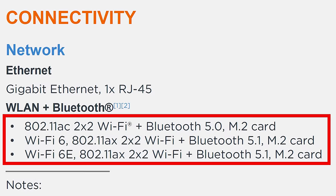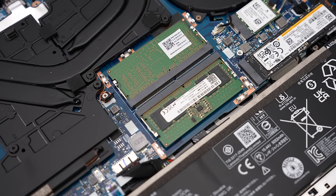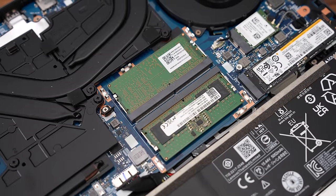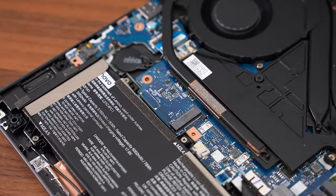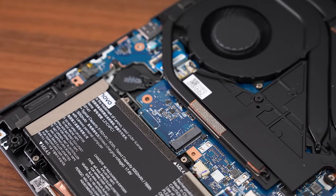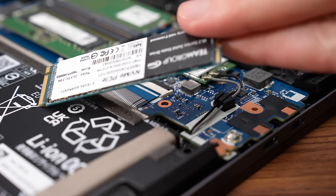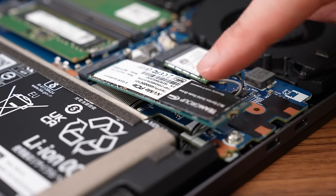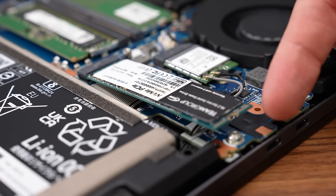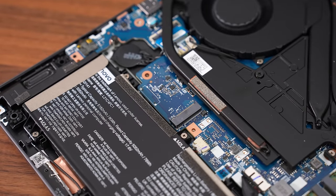Just like the camera difference, if we dive into the full spec sheet some differences are listed. The memory that came in mine was single rank X16, though so far I haven't found this to matter as much with DDR5 compared to DDR4. The installed 512GB NVMe M.2 PCIe Gen 4 SSD was performing quite well, and the second M.2 slot supports 4 lanes of Gen 4 as well. Unfortunately the primary M.2 slot has some limitations — it's not possible to install an M.2 drive with chips on both sides, like this 4TB SSD from Team Group, as the chips come into contact with the cable connector underneath, but this drive fits perfectly fine in the second M.2 slot.